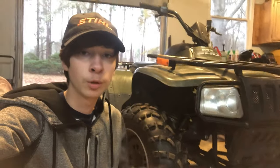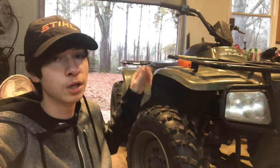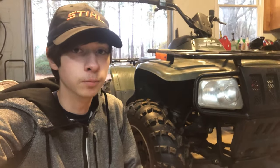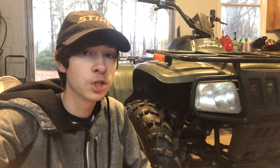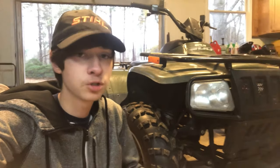So you notice on this carburetor how it's spitting and sputtering and hesitating whenever I press the throttle, and then it like goes on and goes. I played around with the idle air fuel ratio screw because that's where mainly the pilot jet goes through and controls the close to quarter throttle. I played around with that and that was set way too rich. So I leaned it out, I've done a lot of testing off camera, and I've pretty much got it right.